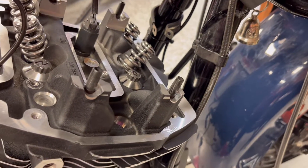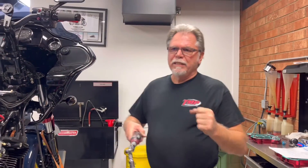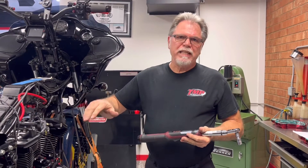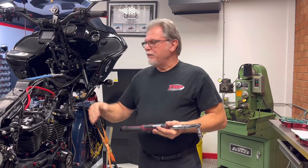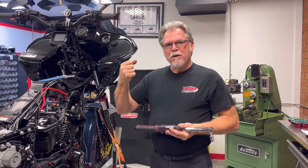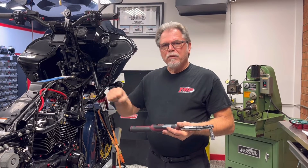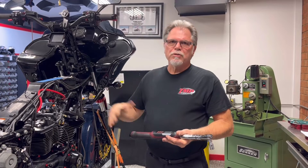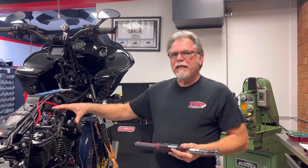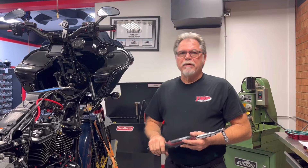I'm a firm believer that I want to give a number to pull to. I don't want to take a degree number, because when I do it the other way, sometimes I'll get one that's 58 and one that'll be 72. That has a lot to do with the way you prep your head. If your head bolt starts to grab or gets tight on the aluminum where you haven't lubed it properly, it will create more friction, which also sets the torque wrench off quicker. So keep in mind, the most important thing is the way that you prep your head bolts and your heads before you start. Thank you very much.